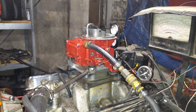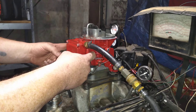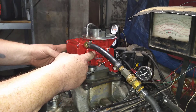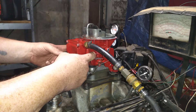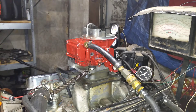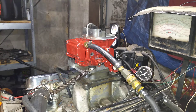Got your carburetor done, found some things done wrong with it, left it the same color — I assume that's what you wanted. We took the caps off here and it had the factory needles in it. We took them out and put the new ones in that you're supposed to replace them with. They have the same point shape to them, so they're just a little bit longer. All the rest of that stuff, you're going to get a bag back with the parts that we took off of it, including gaskets and stuff. So if you want to look at them, they'll be in the bag. Don't just throw them away if you don't want to look at them.